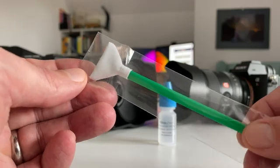It's easy to demonstrate this even without going into the camera body with your swab. If we switch it off and look at the sensor, it rests in a certain position. Now when I switch it on, watch that area of the sensor — you can see how it slips up and is captured in the magnetic field, no longer floating. Let me repeat that effect: switch it off, it comes down; switch it on, and the sensor is positioned by the magnetic field and locked in place.